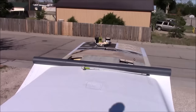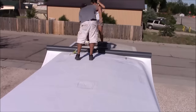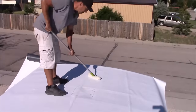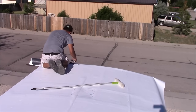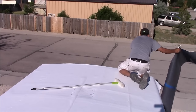Here's a look at what I've done so far — I've done a little over half the roof but I still have some air bubbles to work on. As the roof relaxes in the heat I'll keep working on those. I'm just working my way to the end, taking my time without the glue drying. Now I'm going to go ahead and cut off the excess slack at the end — I don't need any of it, I'm just going to chop it off flush with the back using a utility knife, nothing special.